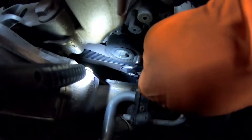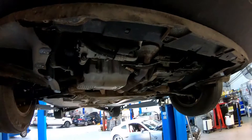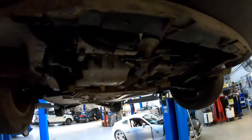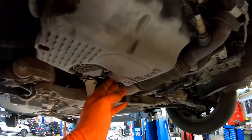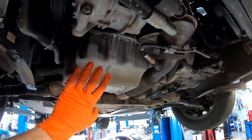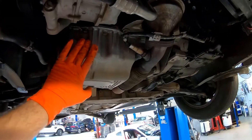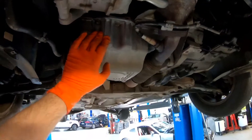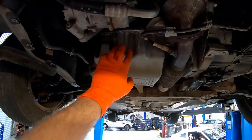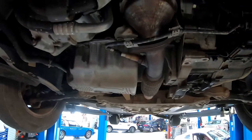We're going to turn this anti-clockwise and it's going to release the belt. So we're underneath the car now, and the first thing we've done is to remove the under tray, and we're going to drain the oil out of the car because we're probably going to have to drop the sump to do this timing chain job. It'll be nice to flush the oil if you're doing a timing chain — to have fresh oil in for a fresh timing chain is always a good way to go, because it's only poor quality oil that wears these chains out and stretches them.